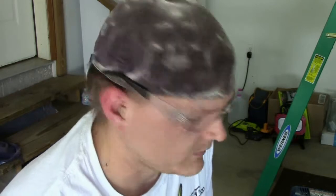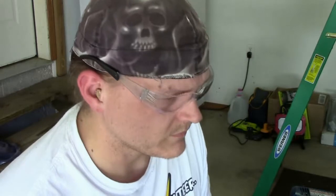So hopefully this will help you out on repairing a wire in your 12-volt system that's been exposed, cut, or has corrosion. The old way I used to do it, before I discovered using the wire wheel, was using emery cloth. The problem with that is it only cleans the side you can touch. With the wire wheel, you can actually get down into the wires.